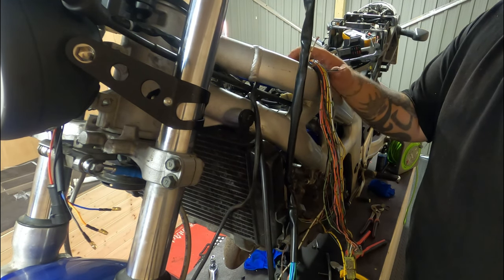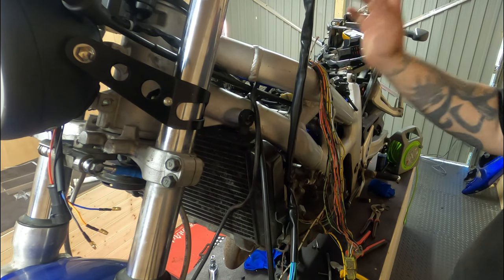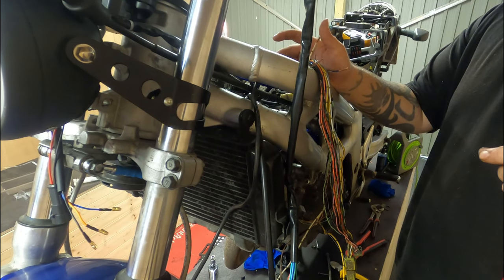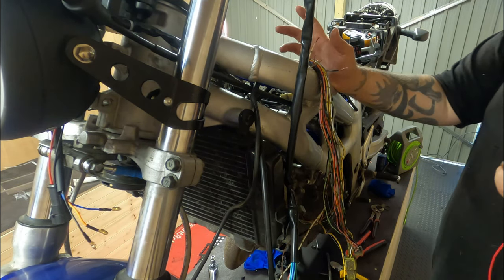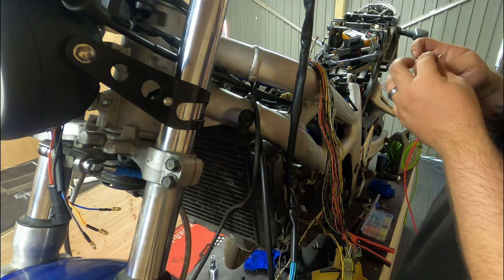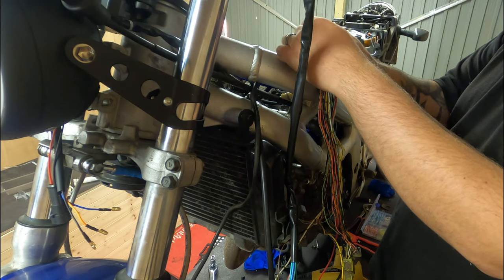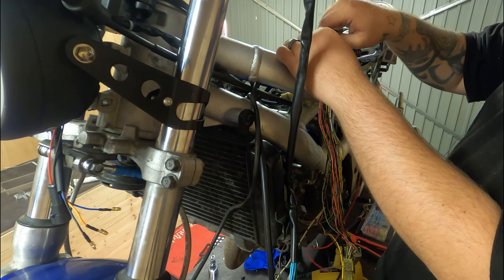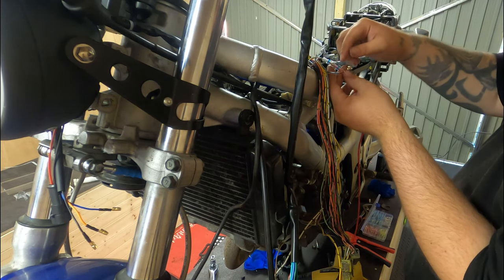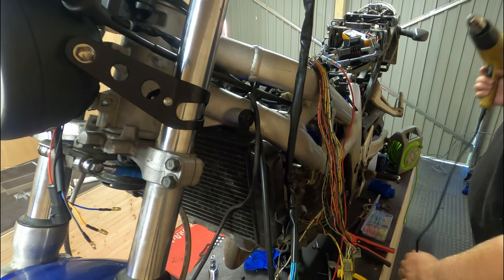Currently we've got those stripped. I'm actually waiting for some cables to arrive because I've got numerous colours coming. But this will honestly do, because we're going to have a cable specifically for that — you're not going to confuse it with anything else. So we're just going to go with two red wires, two black wires, and one orange wire. The orange wire is just going to define the difference between the high beam and the low beam. These connectors just slide right over the top of your cable, and then for the likes of the white wire, we just kind of half splice these together. Once you've got them done the way you want them, just slide this over the top so that the metal solder point is over where you're connecting the wires. You can use a lighter for this — I'm just going to use a heat gun because I've got one.